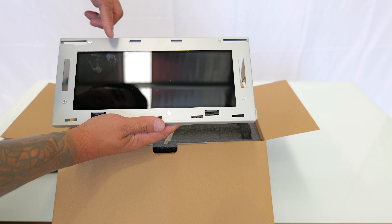Quick note — I forgot to record the first clip, which is just the first panel that is very easy to get off. I'll do a voiceover on this clip. You'll see me putting this panel back on, starting from the very bottom, lining the clips up, pushing up and then in. The clips are at the very bottom and along the inside of the panel. To pull the panel off, pull back and then down — that's how you get the original panel out.